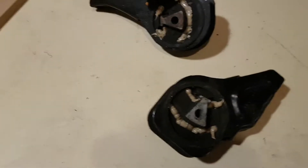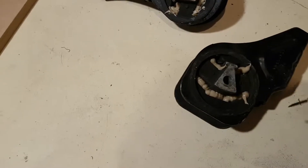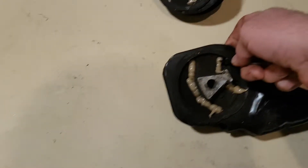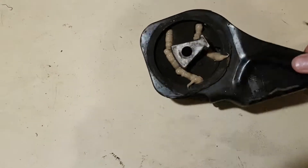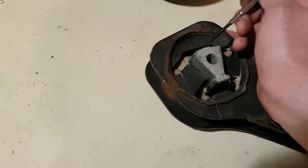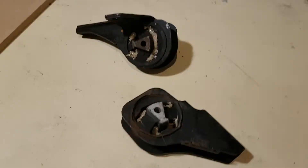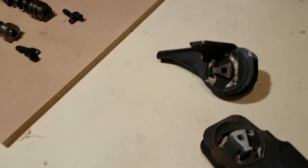Alright, it's been a little over 24 hours since I did the first layer. What I like to do is take a little screwdriver, or something pointy like an awl or a pick, just to make sure that you don't have any soft spots. If there is a soft spot it will basically poke a hole in it and let the air in, and I usually let it sit longer before I do the next layer if that's the case. So this one's pretty hard — it's been over 24 hours, so I'll put another layer on it now.